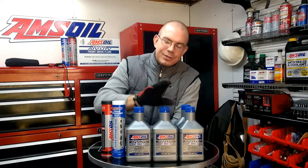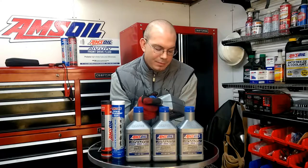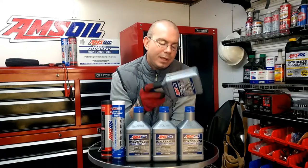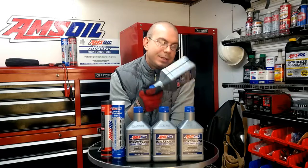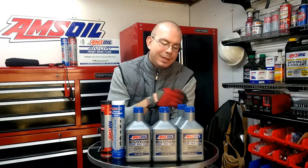Anyway, back to the Polaris on-demand fluid. There really wasn't an alternative to that fluid for the front of that 400 two-stroke, and Amsoil has come out with this now. One important thing I read: it says do not use in applications requiring an API GL-5 fluid. Some differentials can use this, but go on Amsoil.com to make sure it applies to your application. Amsoil also has a separate transmission/differential fluid for ATV/UTV that is GL-5 compatible — I'll cover that next week.